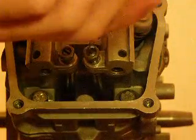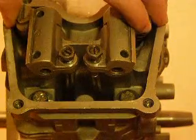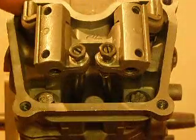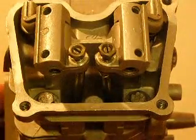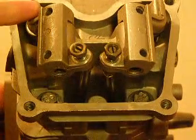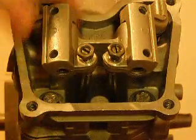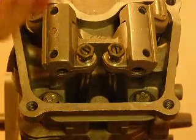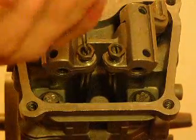The reason for that is because it will wear a lot faster, and also you won't get the max power that you need for your engine. Like the valves wouldn't even open all the way. When you move it, it only opens that much because there's too much slack, even though it should be opening a lot more. You can see the valves barely open.